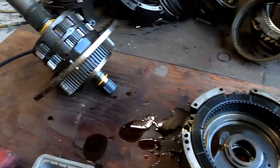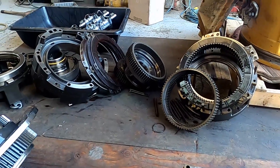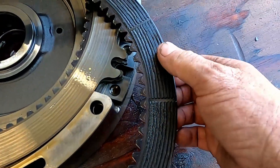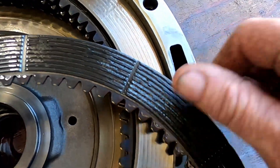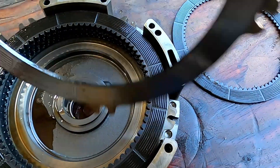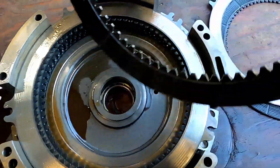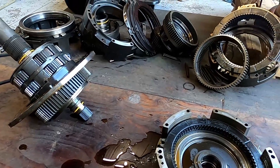I've pulled this planetary unit out of the last clutch pack and I'm pulling these clutches apart. By the way, the rest of the clutches look pretty good — there's some wear and stuff but nothing real bad. We are going to change all the discs. But when we get to this last one, these are a kind of different clutch — not the paper fiber kind. They seem rubbery, got a whole different texture. This one's starting to shell apart really bad right here — it's just kind of crumbling. Definitely going to get some new clutches in here. I'll go through and mic the plates to make sure they're not warped beyond spec. So it was that top clutch that failed. And it looks to me like we had an operator who tried to fix the problem by continuing to drive the dozer, figured it would fix itself on its own, and it didn't — it just made it a lot worse and cost a lot more money.